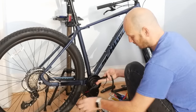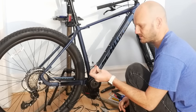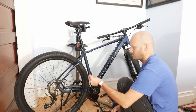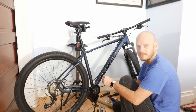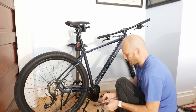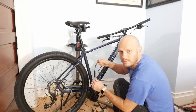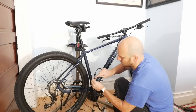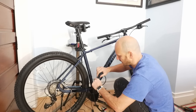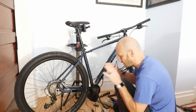What are all these wires? This goes to your motor, this goes to your battery. Some motors have a 6-volt output which powers lights, controlled from your display. This is your speedometer pickup, this is your gear shift sensor, and this is your main wiring harness which runs up to your display, brake cutoffs, and throttle. Do a dry run first — get your main cable out, plug it in carefully. Make sure the lines are lining up and use constant steady pressure. I've bent these pins before — it sucks — but if you do, just order another cable.